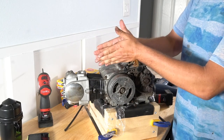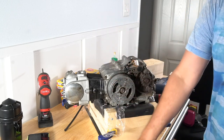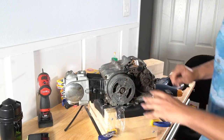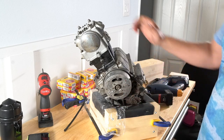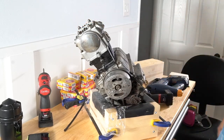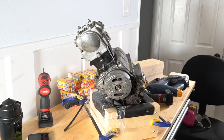I don't understand the metal frame stands because everything is bolted down and you can't work on it. When you're trying to split your cases, having the engine bolted to a fabricated stand just doesn't work. As you can see, I can do anything I want with this engine stand in any orientation, and it's sturdy — it's not going anywhere. Hope you guys like this video. I think it's pretty basic how you put it together and I've given you dimensions for these horizontal engines. If you build one, I think you'll agree it's a fantastic tool. Subscribe — I've got a ton more videos coming out. See you guys later!